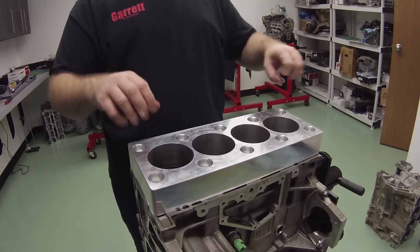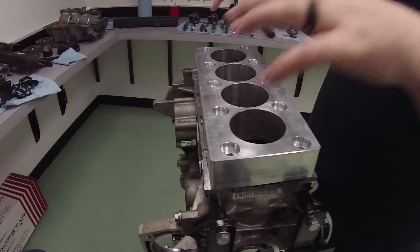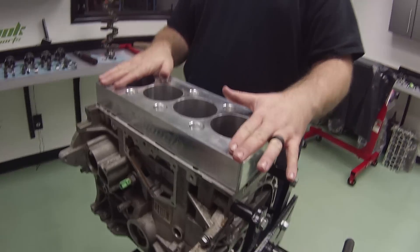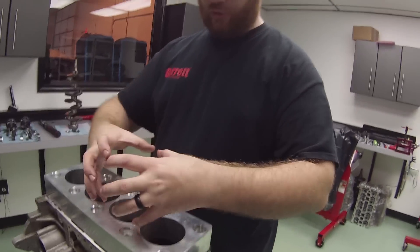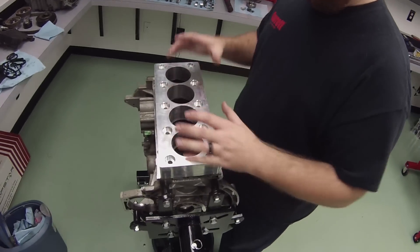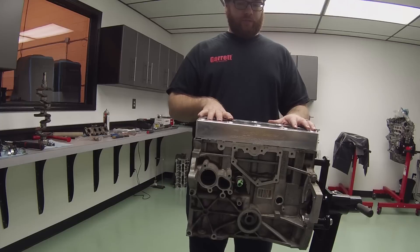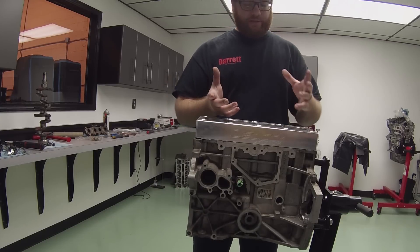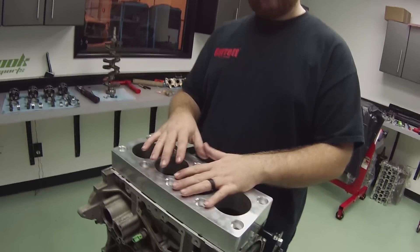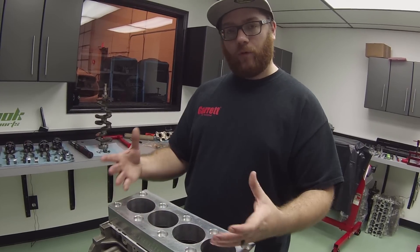This is supposed to simulate the cylinder head. We'll put the head studs in, and the head studs will get torqued to the same spec as if the cylinder head was on it. What that does is distort the bore in such a way that when we bore and hone it, it's going to be perfectly round when we put the head on afterwards. If we were to measure the bore right now without the torque plate, it would be out of round - egg-shaped, tapered, with all these defects. With head studs there's a lot more stress than stock head bolts, so it's going to distort the bore even more.